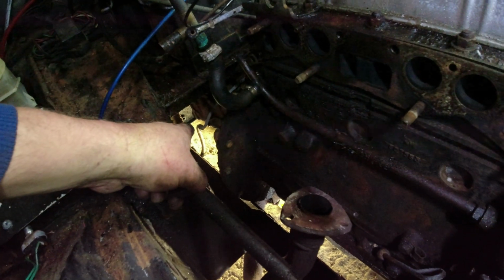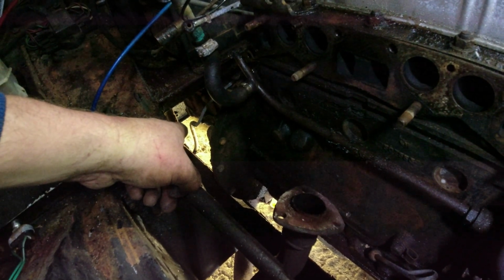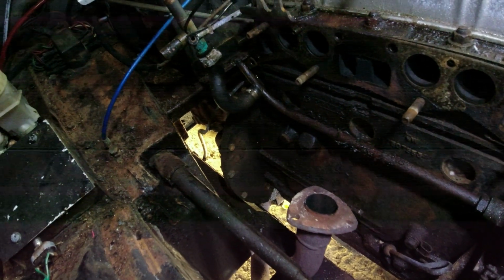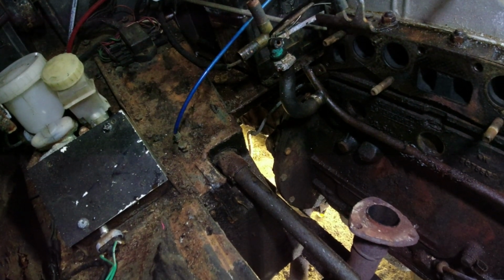Now I've just found another flexible. Now this is all off, down there I can see a flexible fuel line. And it's stuff like that that gets missed when you're replacing all of the fuel lines. How about that? So that's going to come out, and then of course I've been up here scraping all the bloody paint off, and that wasn't white, that was bare steel.